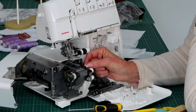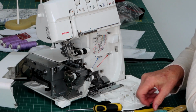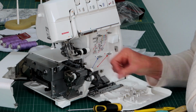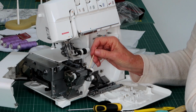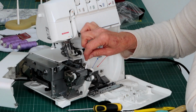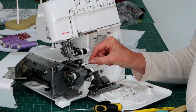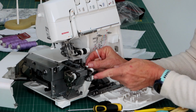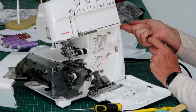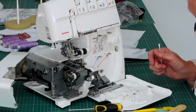Yeah, and I always like to take my roll hem plate forward and backwards, because you can see that this machine even has a little bit of cotton threading. You just move it up and down, and you can clean inside that section there, once again with the earbud, to make sure that it moves nice and freely. And underneath, this mechanism is what moves backwards and forwards to give you your MTC. It moves left and right for MTC and up and down for your roll hem.